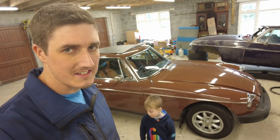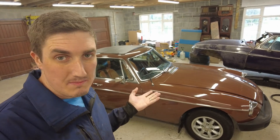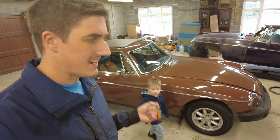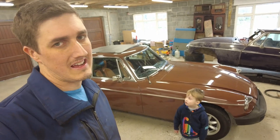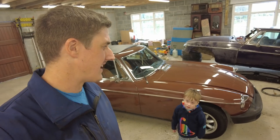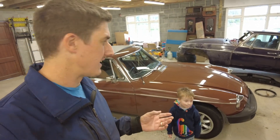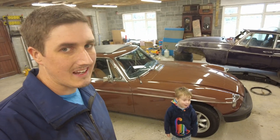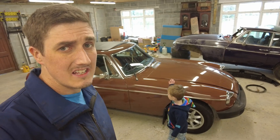Okay so it's the following day here and I've got my little assistant down with me and we are going to get stuck back into this. The state of play is: the brakes are spongy as hell but that's literally because there's air in them. Number two is the plugs fouled up in the engine and the engine started running like crap after a while. So we need to clean the plugs, check our timing and mixture and all of that. I need to get it within some sort of a ballpark, then get a fresh tank of petrol and tune it properly because it's possible the plugs got fouled up because of dirty petrol. Two jobs basically - if we can get both of those sorted out then I'm happy enough to take it up for the run later today. It's about 30 miles by the way.